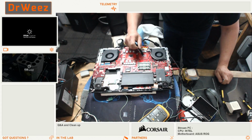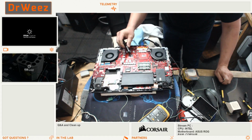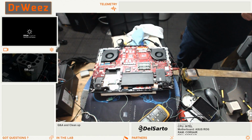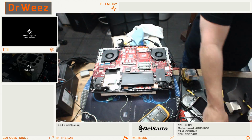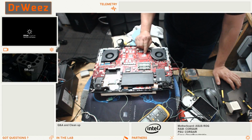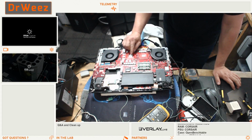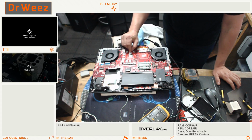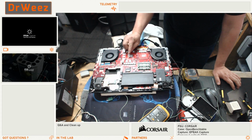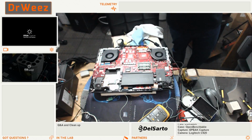The session today will probably be about 30 minutes to an hour, if we've got enough nitrogen to go that long. We've got to watch out for condensation. I haven't prepared the motherboard with Vaseline or anything to that effect. We won't be running temperatures at the extreme end of liquid nitrogen. We'll really only be running the pot at around -10, if even that much, just below the condensation point, the dew point. And then the processor will be at around 40 degrees internally.